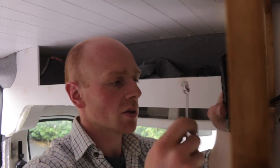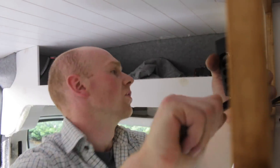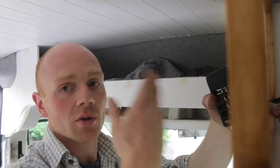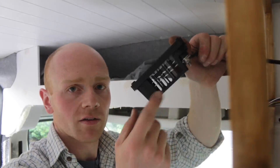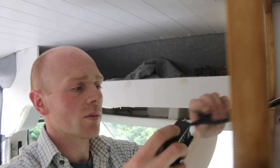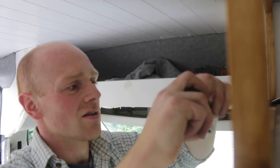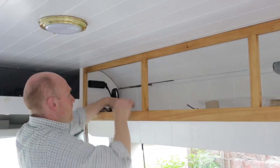I've just spent about an hour trying to get a bolt to the bodywork for all of our negatives to go to. I've gone right behind a pillar, sanded off all the paint, put a bolt through with shake-proof washers and a nut, and now all of our negatives are going to go into this. We're not grounding stuff to the bodywork just where appliances are — we're actually bringing everything back to one point. It uses a bit more wire but at least if anything goes wrong we know where it is.